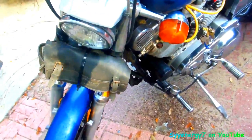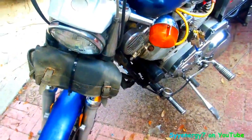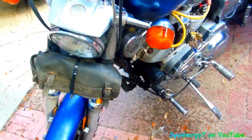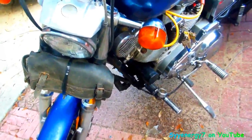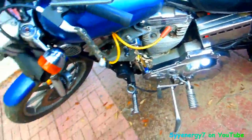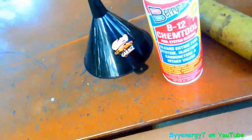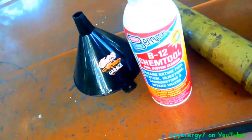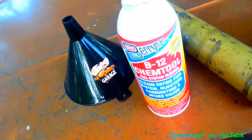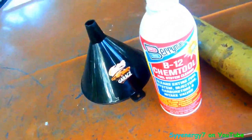I don't have the blow-by problem. If you put it at full and you're running it for an hour, all of a sudden it's going to be a little bit over full, and right at full you're going to start getting blow-by. I don't know why they make them like this, but you've got to figure out the little things and then you're fine. This time I put about half a can of this B12 in here. I like this a lot better than Seafoam — this stuff has been around a long time and to me it's the best.